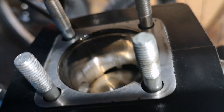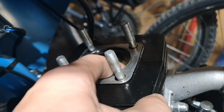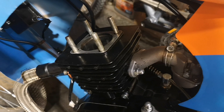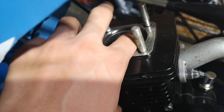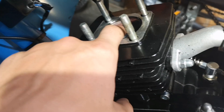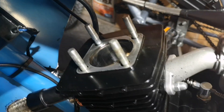Taking a look at the cylinder, it honestly looks really healthy. You can run your finger over the cylinder bore — I don't feel any scoring, I don't feel any chrome lining peeling off, and overall the cylinder looks in really good shape. On these you want to feel no digs or marks. If you see a mark but you can't feel it, that's completely normal — those are just called scuffs. Right there it looks like a scuff, but when I rubbed my finger over it I didn't feel anything, so it's not a big deal.